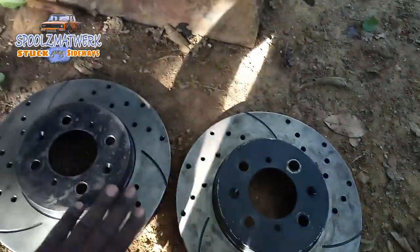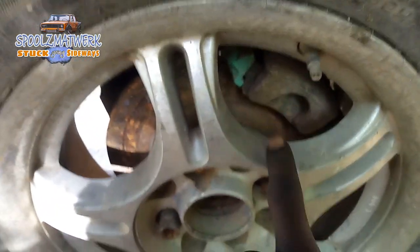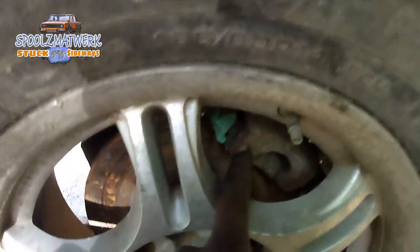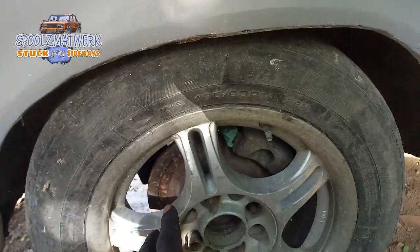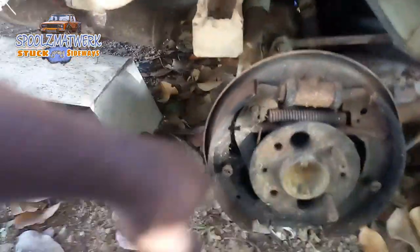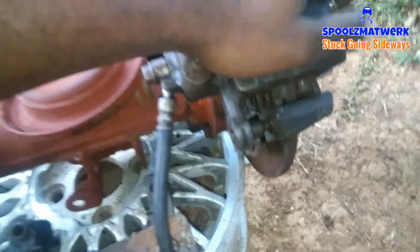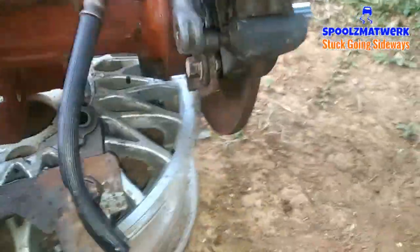Since I'll be going faster at a quicker rate, you need brakes. I checked these brakes on the website — they said they are rated for high temperature and extreme braking. I bought these for the Honda ES1 and it's not something new; I've done it before on the rear of the car. These are Nissan B13 brakes — Nissan Sentra B13 — and I converted them to the LADA. That was the first conversion I did on the car, because the LADA came with drum brakes.